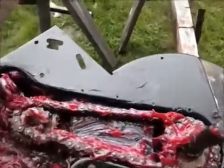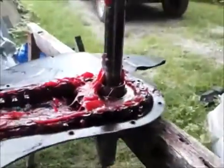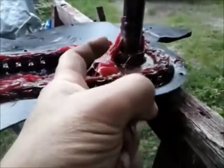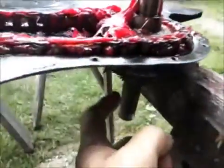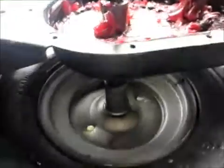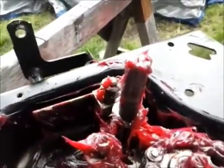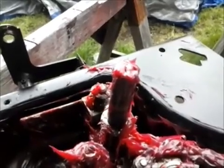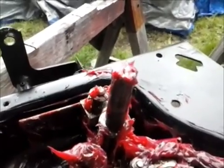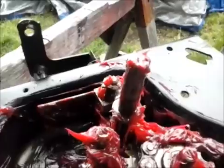If you really wanted to do a good job on this repair, I would think about putting grease zerks on the housings, on these bottom shafts here, and maybe even on these axle shafts for the wheels. The problem with this input shaft that burned up was there was really no way for lubrication to get back up there once it worked its way down as the thing ran. So I've got the grease zerks on that one now, so we'll see how that works out.